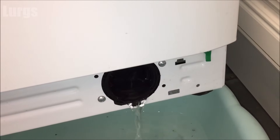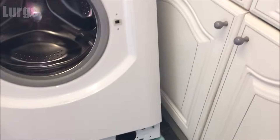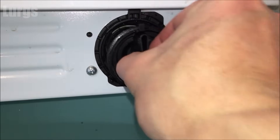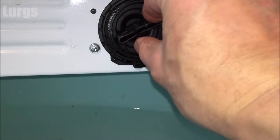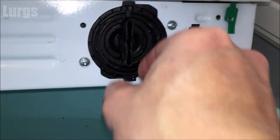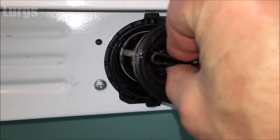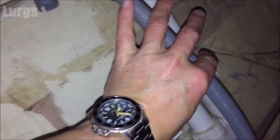You will get a lot of water if it's stopped mid-cycle. Once you're happy all the water is drained out, you can screw the filter back in. This should be very, very easy — just turn it in and there you go, that's fully tightened. I'm just going to unscrew it again to show you how easy it should be, but I was having real trouble earlier because that hair clip and the 10p piece were getting stuck and I couldn't turn it.